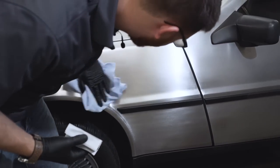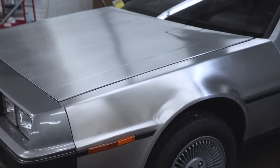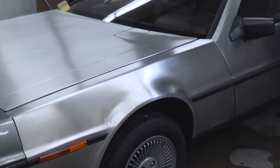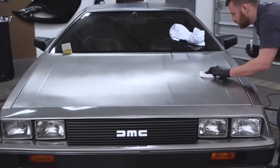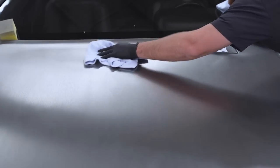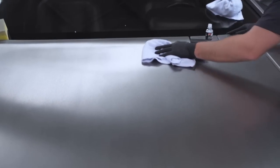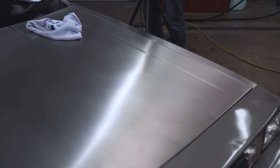I know there are different methods out there. What this car really needs is to be retextured — we just didn't have the time. You take Scotch-Brite and go front to back with it, really get it clean, and you can get a lot of the surface scratches out. We just didn't do that; we didn't have the time. But I think what we did definitely preserved the vehicle.